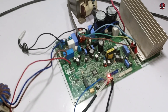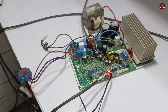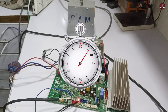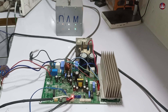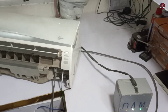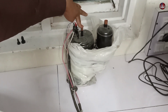Let's wait to see whether this motherboard starts the compressor or not. The motherboard has started the compressor. All phases on the UVW analyzer are fine and the compressor is also working fine. And now the motherboard has stopped the compressor.